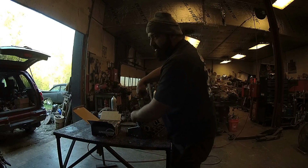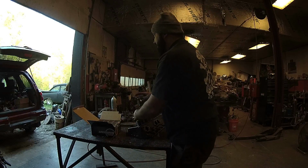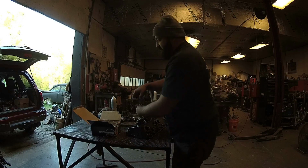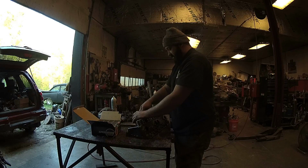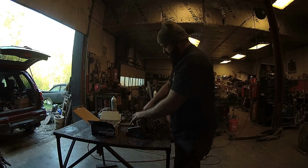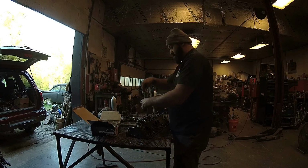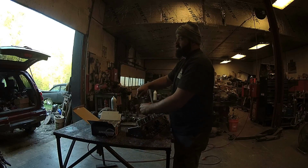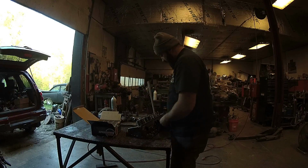These remind me of when we was putting valve springs on Dad's 57, that roller cam. Man, them things is tough. I guess I've just got used to doing hydraulic roller springs. So doing these solid rollers, I mean, they got some freaking pressure on them. The thing is, I absolutely do not recommend running this combination on the street. I mean, you can run it up and down the road, like what we do, like take it for a street down or whatever, but I would not drive this thing in traffic.